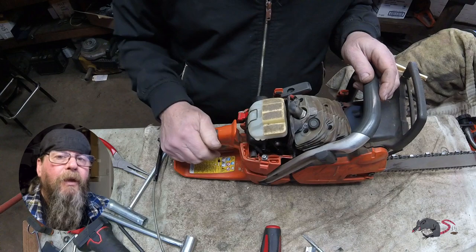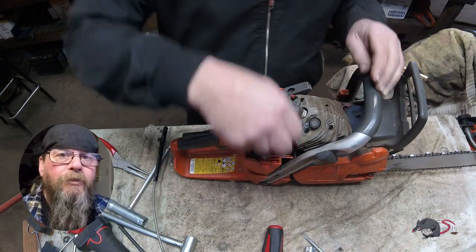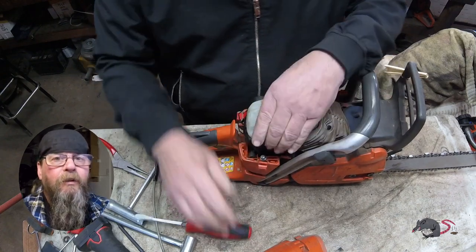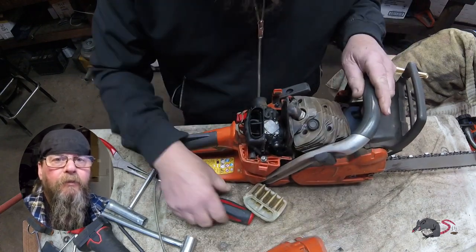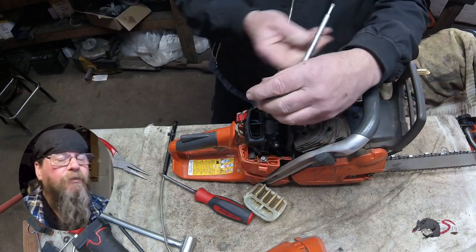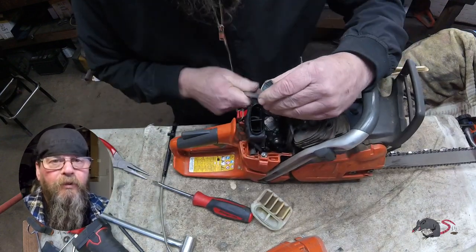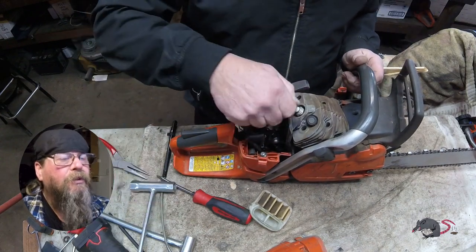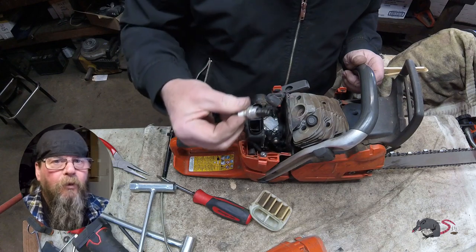You might be asking: how often should I change that filter? I would give you the standard Husqvarna response that it depends. If you've got really nasty fuel and the filter's getting brown, definitely replace it. But otherwise Husky calls for 100 hours or monthly.